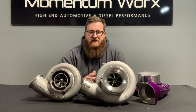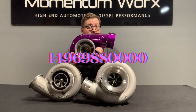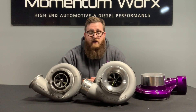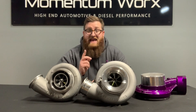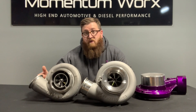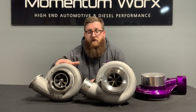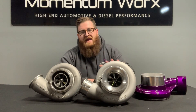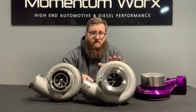This is an S410SX with a V-band style cover, and this is the Caterpillar style cover — the Quad Zero that everyone talks about — which fits on this turbo. You can get the S410 in a V-band style in 78mm and 80mm, or the Caterpillar style in 78mm, 80mm, and 82mm. The S400 is also offered in different compressor cover styles: V-band or slip joint. There's also a difference with the wheels — the S400SX is a 7+7, and there's an SXE series with a billet 10-blade. The S410 does not come in an SXE; it only comes in SX.